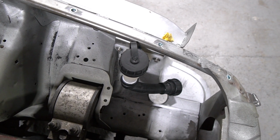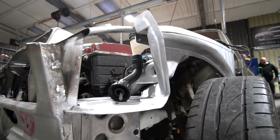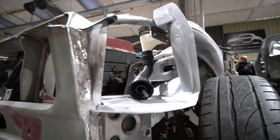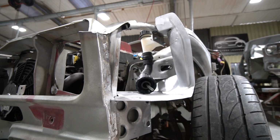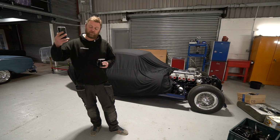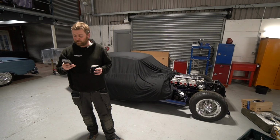They do various car components, but one of the things they do is washer fluid systems, and they do a great range of washer bottles of all sorts of different shapes and sizes, with integrated pumps in a lot of occasions. Interestingly, some of them come with pumps that have a Deutsch DT connector socket on, which is very nice that it's got a decent quality socket, because most of the universal ones have some crummy little spade connection on. And they also do screw-on flexible necks of all sorts of different lengths, from massive to incredibly short. And they also do various jets.